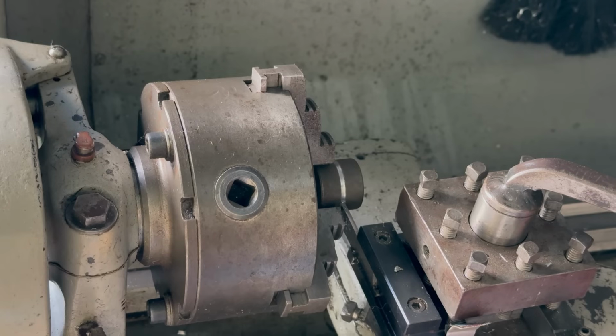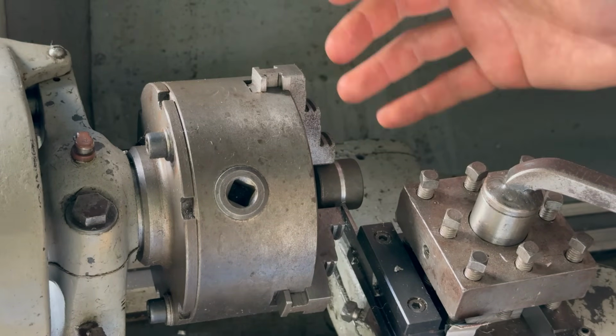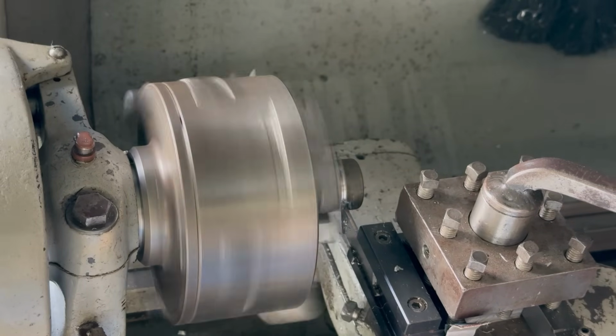So I've just got to make up some little spacers to take in the gap from my piece of flat bar over across to the chassis rail. So I just found this piece of scrap round stock. It's already got a hole drilled through it. Just going to split it in half and that'll give me 2. And then I'm going to have to make another 2 from scratch. So we'll just go through this with the parting tool and then we'll make the other 2 spacers.